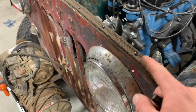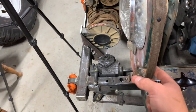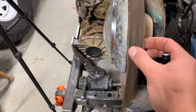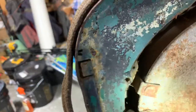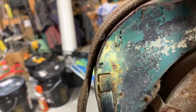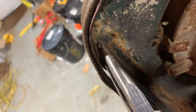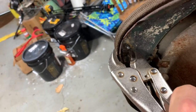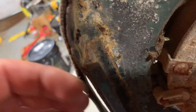To show y'all my technique: you're going to stretch it every time you do one of these, that way you make sure you have enough at the end — it's better to trim some off than to come up too short. Once you take your awl and punch your hole, stick the rivet in. Don't worry about the direction too much yet — take your screwdriver and kind of flare it, then take your needle nose and pull on it while you flare it back, then finish it off with that homemade tool. See how that pulled it in while it smushed it down — now that's nice and tight and it ain't going anywhere. Just keep going down through here.